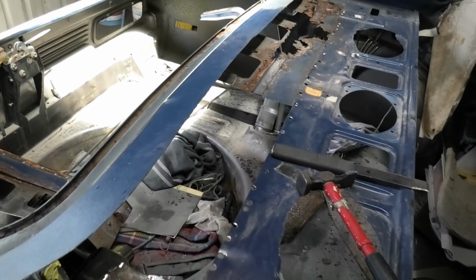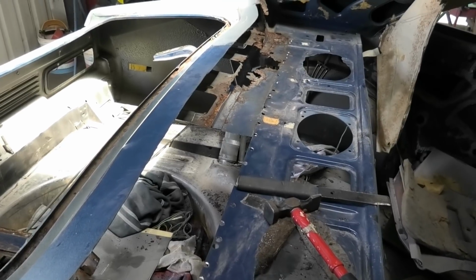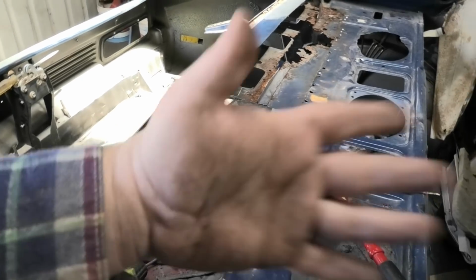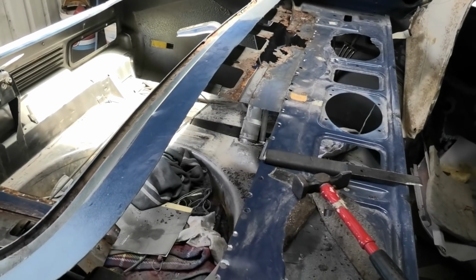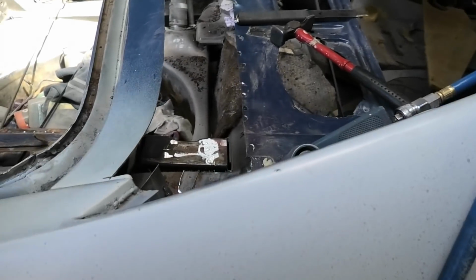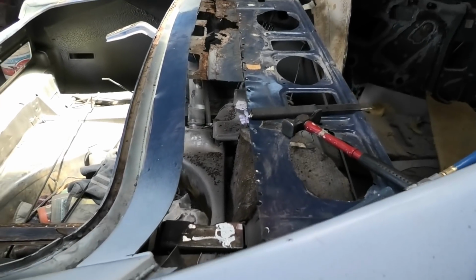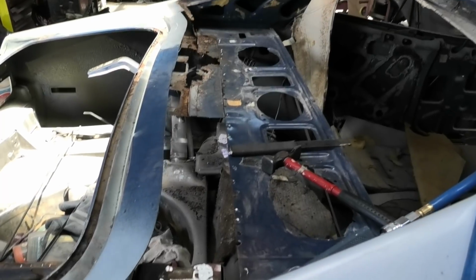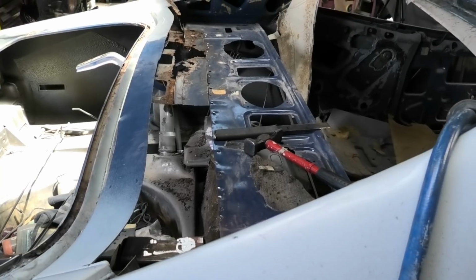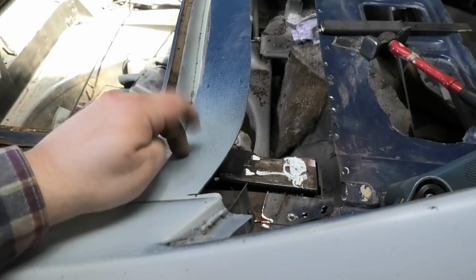This is one of those few repairs where you don't really have to brace too much, because the way the car is built, it's holding itself incredibly firmly anyway. I mean, if you took out the whole panel and all of this parcel shelf, I'd recommend maybe just a little brace between the window channel. It all depends on how rusty your car is. If your car is an absolute pile of rust in close formation, I'd recommend bracing it, but this car is stupidly solid for a Falcon coupe, so I'm not actually that worried.